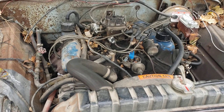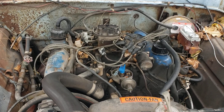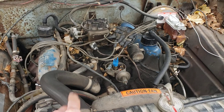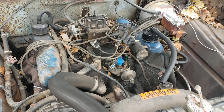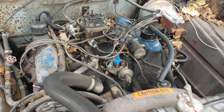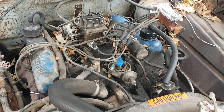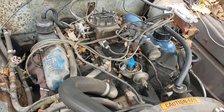Welcome back to the channel. Today's video is on a 1969 Ford F-250 featuring the 360 V8, but the theory we're going to discuss applies to a variety of timing chain operated, distributor-equipped engines — V6, V8, Chevy, Ford, Dodge, doesn't matter. We're looking at timing chains and distributors, specifically whether your timing chain has jumped, has slop in it, or both. It can only jump if there is slop, or if it broke.